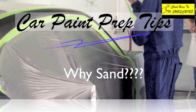You're sanding it to rough it up, because sandpaper has a grit in it, and you're actually putting small little scratches. It's fine scratches for final sanding, but you're putting fine little scratches so the paint will fall in those scratches and give it something to bite to hold on to. That way it doesn't peel. You have good adhesion. So we're actually sanding to rough the surface up. Just kind of wanted to mention that, so there's no confusion there.